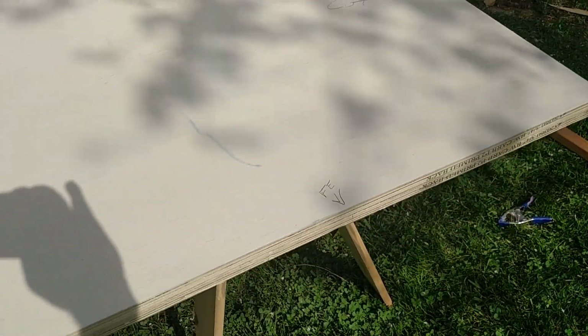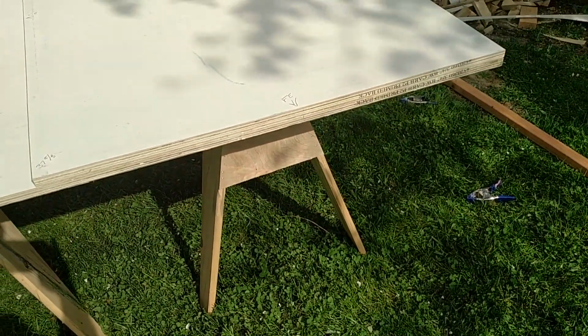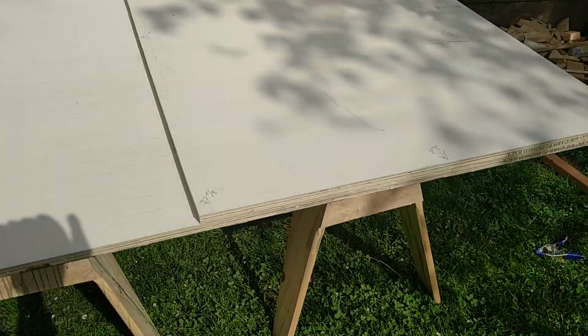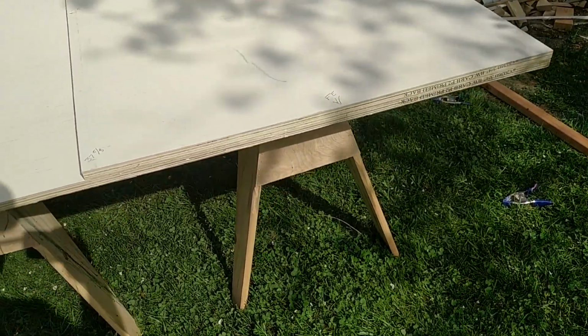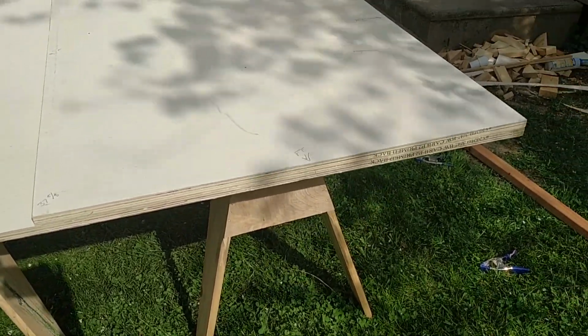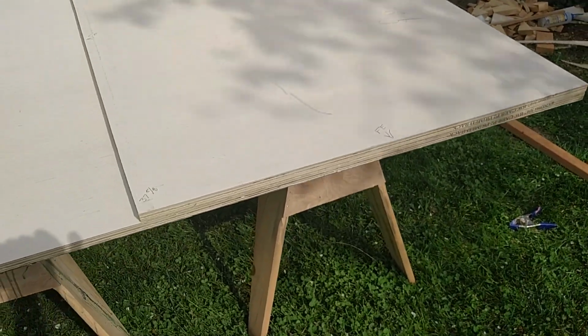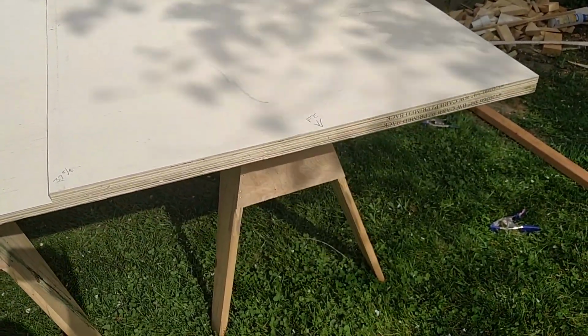We're working on baffles now, and with this fourth order enclosure that Jude designed at Bassaholic Productions, this is going to be a triple baffle. All the subs are going to be on the same baffle, so we're making a triple baffle. Now I know my measurements inside were just a hair off, and it happens.